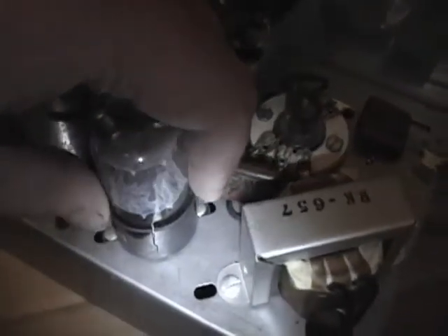It turns out I was wrong — it wasn't just one screw on the back. I took all the screws off around the front and now it's open. Right off the bat I can see one wild-looking tube that has two caps coming out of the top connected together, which is odd. The base looks a bit cracked, so if the tube isn't better it might be hard to find a replacement. It's a 7193 — I'm not really familiar with that.